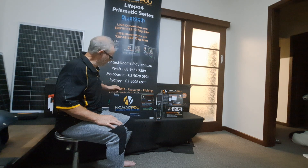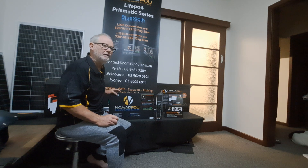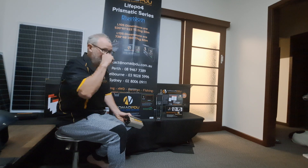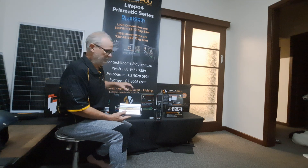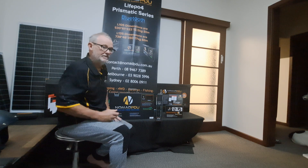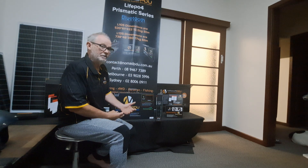The 105 unit you can see here — it does have the battery poles on the top, over here. These are added, so they're a 100 amp constant output and do come with the fittings. You want to be running the correct gauge wiring. If you're running an inverter you've got to make sure the cabling is correct — you can't just run a flimsy bit of wire. If it's going to run a 1200 or 1500 watt inverter, cables need to handle that capacity — about 9 or 10 mil thick. A 100 amp constant output.